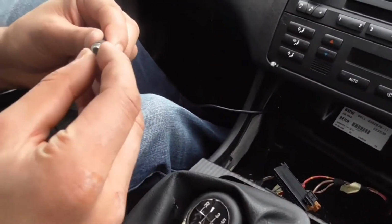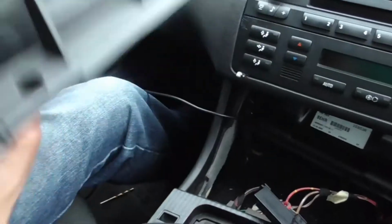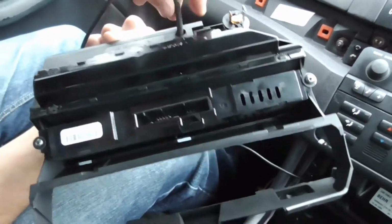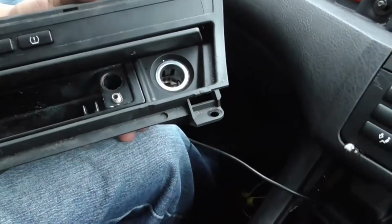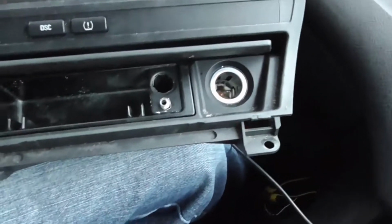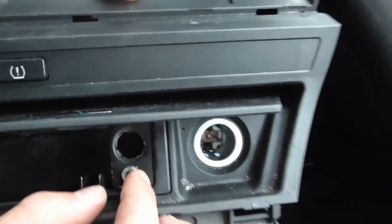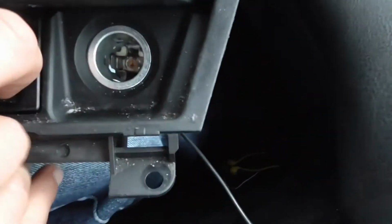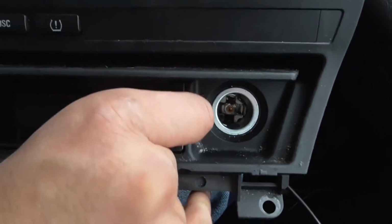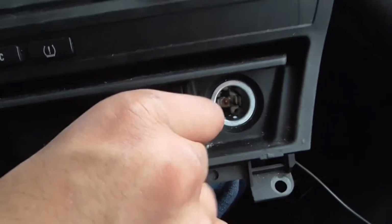Washer. I think it's got the washer in front. Yeah, it has. So as I was saying, you've got your holes just drilled in there now and through the back. What you want to do is feed this through there, and then it'll come through there, and then there should be a washer like this, a small washer that goes on the front of there. Make sure you take it off before you put the cable through, and then just twist it on so it holds it in place. There you go, that's there. So obviously that's not going to go anywhere now, it's tight.